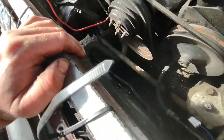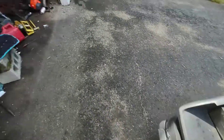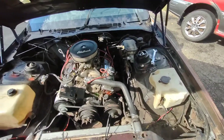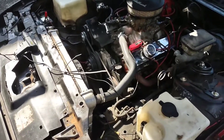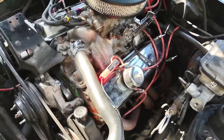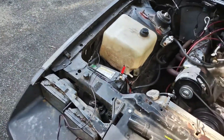I also found out I got a leak in my radiator, so that's great. It's a never-ending thing. So we're going to go grab my timing light — right here. We're going to put the number one spark plug back in and get that all hooked up. Spark plug's in, that little connector's on the number one spark plug wire, and this is hooked up to the battery.